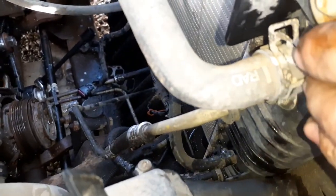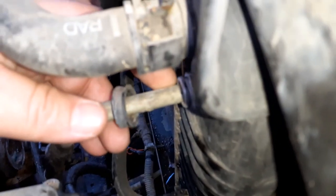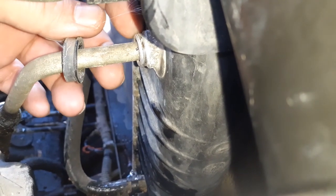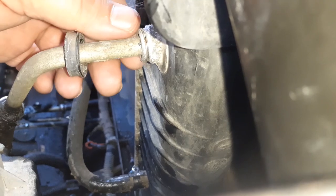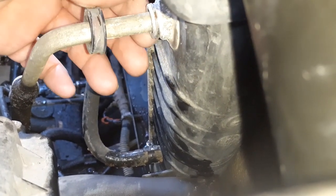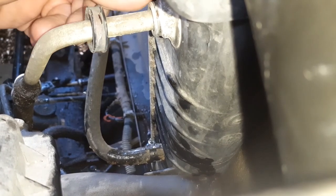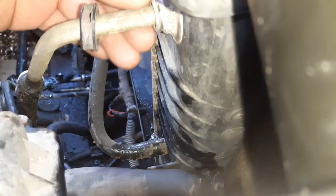Your hoses are already off because you took the water pump out, and now you've got to take the transmission lines out. There's a little metal clip in between there which is hard to see. If you get a screwdriver, find the bottom of that clip and push up on it and get one of those dental pick tools and stick it in the hole in one of the loop parts, you can pull it out. Try not to drop it because those things are easy to lose.